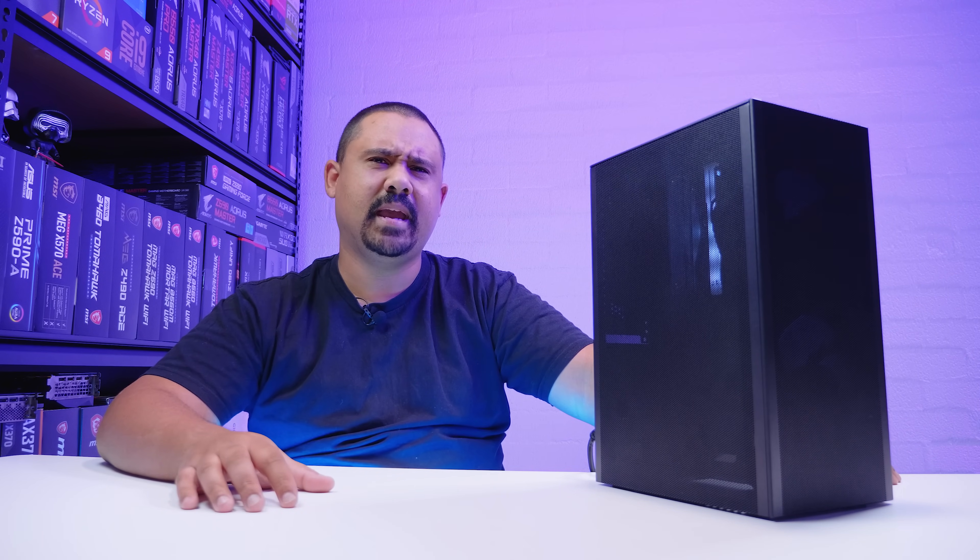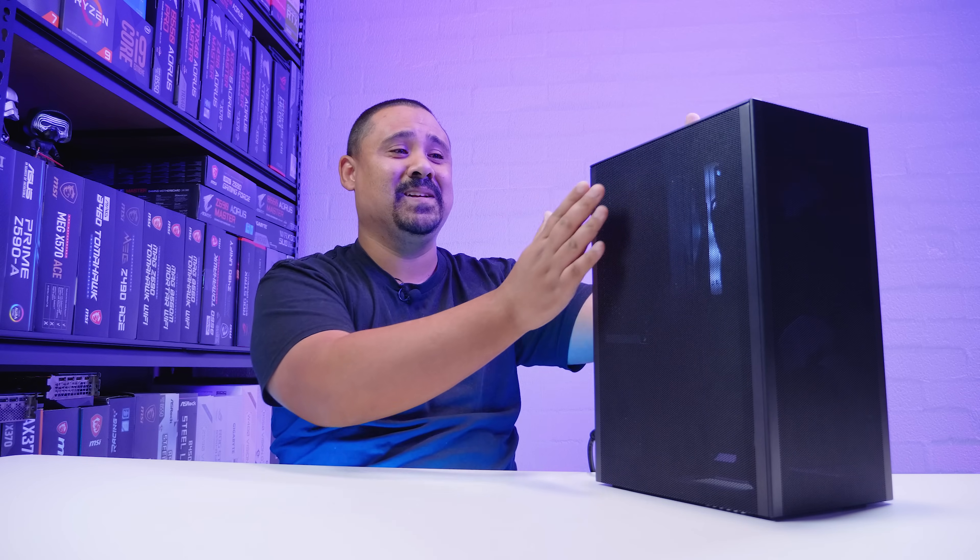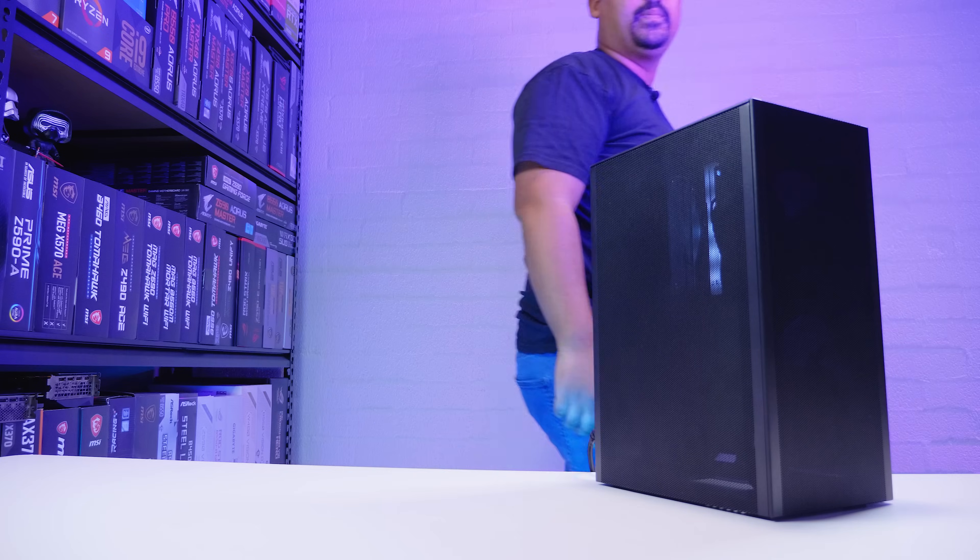I think that's just about going to do it for this video. I hope you learned something. I hope I addressed some questions you may have had on our other Meshlicious content. Air cooling in this case turns out that it's not too bad. And with this cooler, which was a nice surprise, you can put a proper 120mm fan - not the half-height 12.5mm fans, but a proper 25mm fan. It is tight - it sits up against the panel - but I think it's worth it considering there's about a 20 degree temperature difference, which is huge. Not only is it huge for cooler CPU temperatures, it also probably won't heat up your room as much. If you like the music you heard here, I make all the music and it's available over on our Patreon. For early access to videos like this, head on over to Floatplane. Thank you so very much for watching. I'm Nick with Gear Seekers - you peek, we seek, and as usual, it's time to engage cinematic mode.